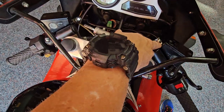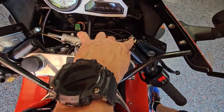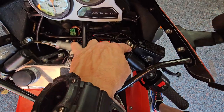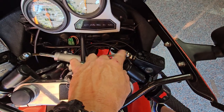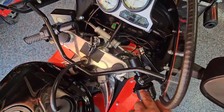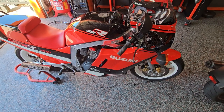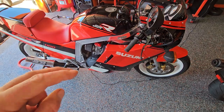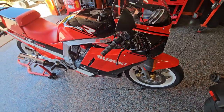So what I'm going to do — I found a double banjo, sorry — a brake light switch that just threads in, and those two wires will connect. I have to cut that off, but I'm going to save the stock switch because they're kind of hard to come by. I'm going to see if I can insulate the two terminals so they don't touch where the wire comes into the switch — see if I can save that.